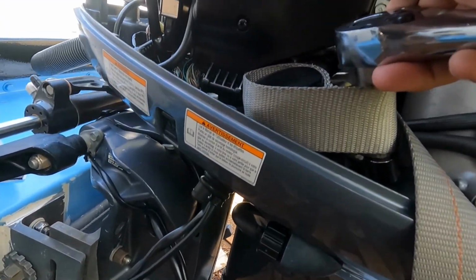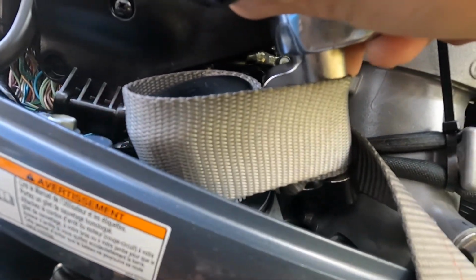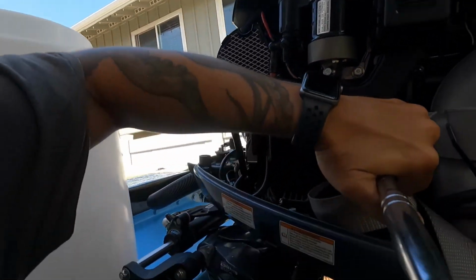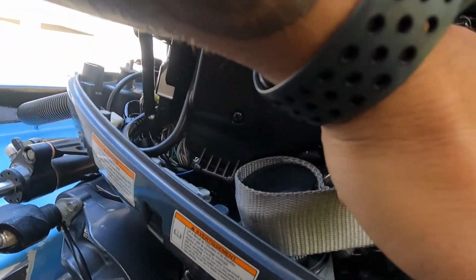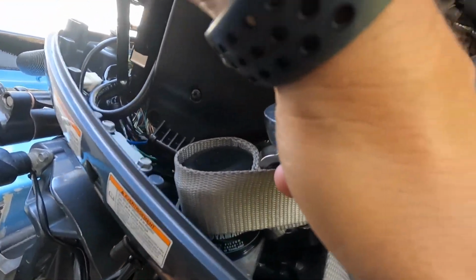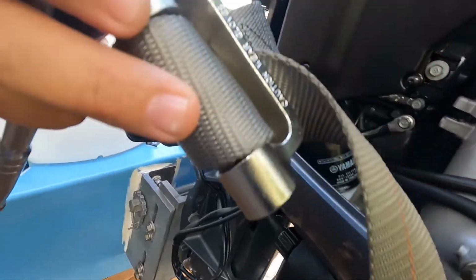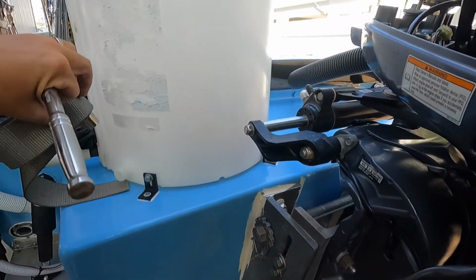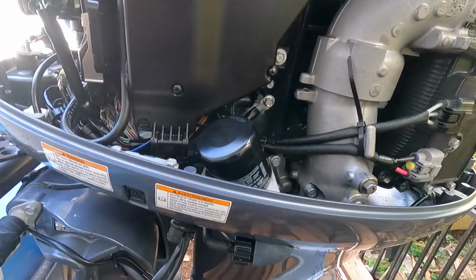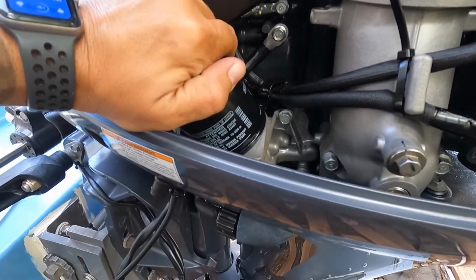It's hard to do with one hand, but it's possible. So when you get this tight, just make sure you're going the right way. Get tension on it and twist, and it breaks it free. Spin it on. There we go. Simple. It helps out if it gets put on too tight, it'll come right off. Alright, once you do the strap loosen up, make sure you can get it by hand, and we're good.